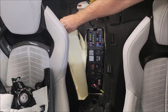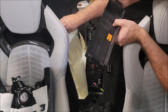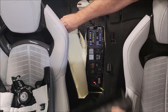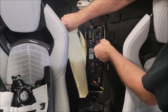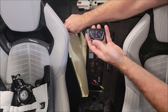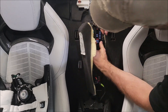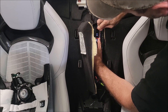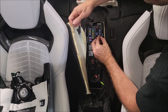Now you've got your fuses. You can even look in the cover — there are two transmission fuses. The one I've been pulling is F5, which is a 15-amp TCM fuse. Count: one, two, three, four, five — it's the bottom one. There's no fuse puller tool like they used to include, but the good news is you have your GM key. Use the key as a little pry bar, wedge it in, and pry until it pops out. That's how you remove the 15-amp fuse for the TCM.